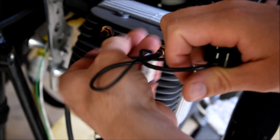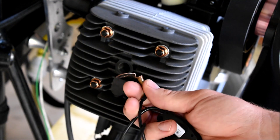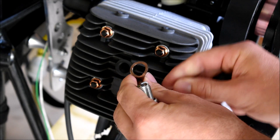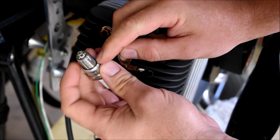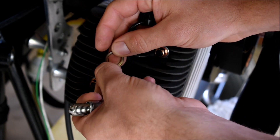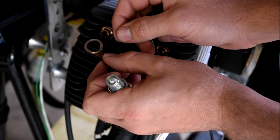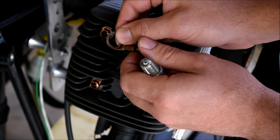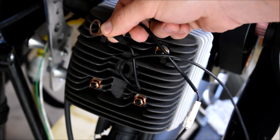Well, there's an issue. If you install this sensor the way Blackhawk recommends, look at this — it's oblong. You know why? Because there's a taper on this crush washer here, you can see it, and it spreads this sensor apart. What do you think that seal does if you're running it like that all the time? It probably leaks a little bit. Don't do it Blackhawk's way.